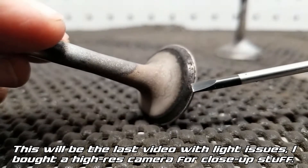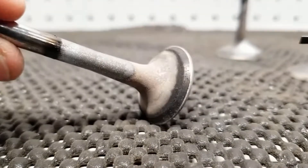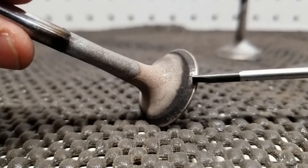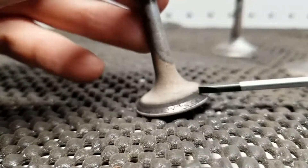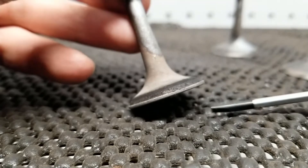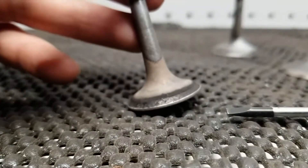Again, this one hasn't been cleaned. I've cleaned everything else — I just wanted to leave one exhaust and one intake to show you what's going on here. What'll happen is if you have excessive clearance on your valve where it's trying to seal into the cylinder head, on the exhaust side during combustion you're going to have combustion gases exiting through the exhaust. You're losing power and essentially losing compression through the valve — that's basically what I'm trying to explain.